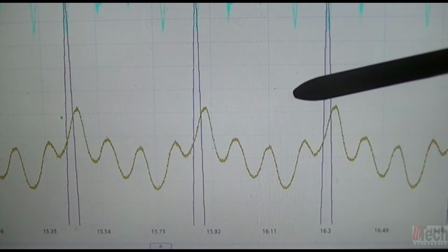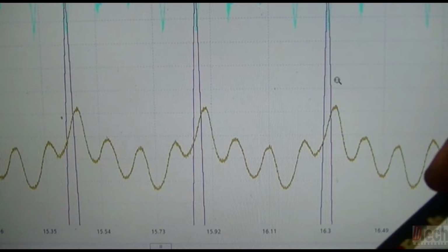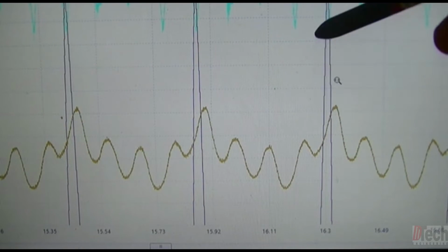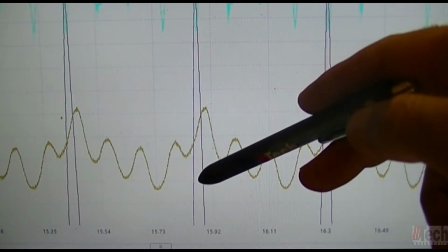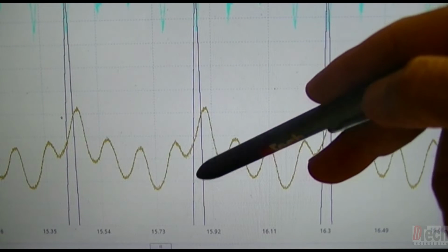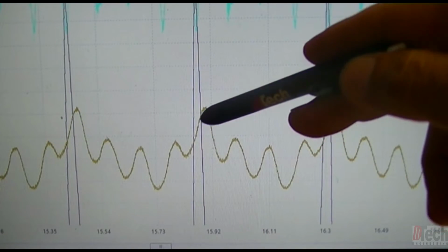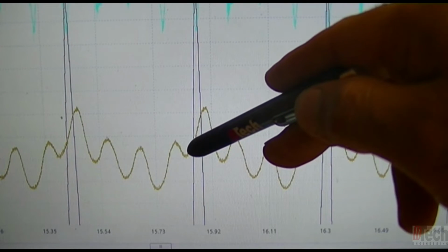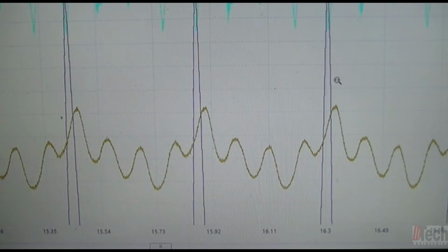And if you look at this, and again, if you're trying to learn, you can confuse this from this purple, which is cylinder one, going on top dead center on the in-cylinder trace, and in time correlating to each other. You can mistakenly make a call of possibly saying that the intake valve on cylinder one is bleeding off into the intake manifold, because during compression the pressure seemed to rise when cylinder one was on compression. Again, it's not a bad hypothesis, but like I've explained before, you have to rationalize everything that is going on in the engine all around.